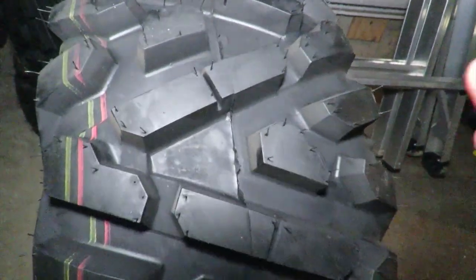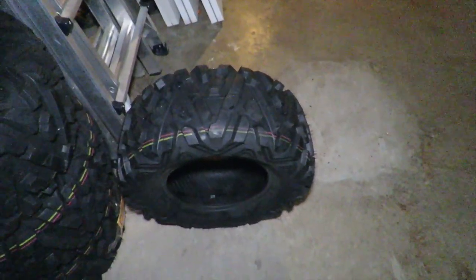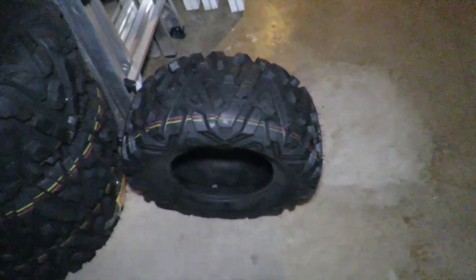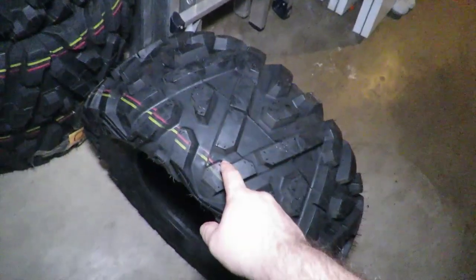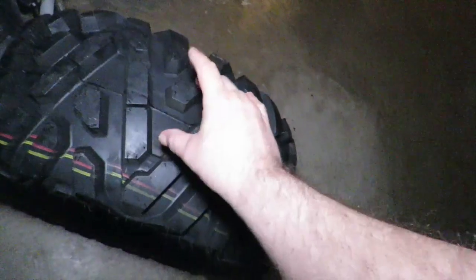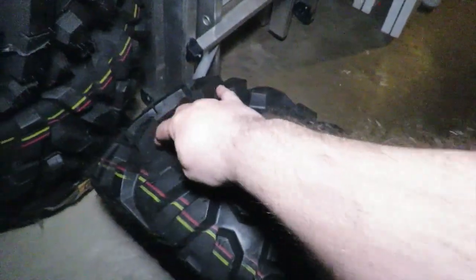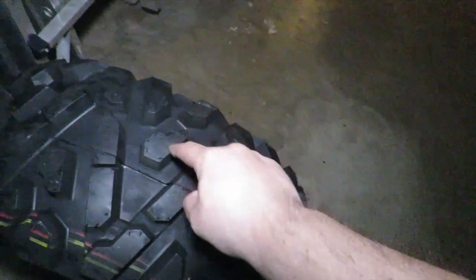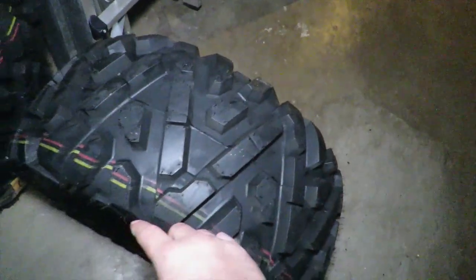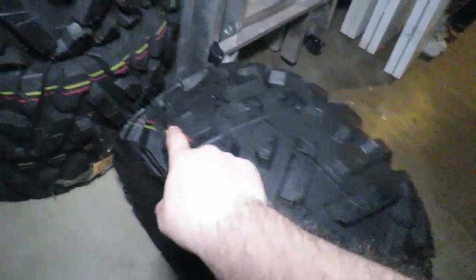The center here — this is the way your tire should rotate. I see a lot of people just mount them on their bike and say it's non-directional. Well, it's true and not true in my opinion. They are directional — you want your lugs to grip in the proper way, especially these small ones. These little knobbies, especially where it matters, is on the outside.